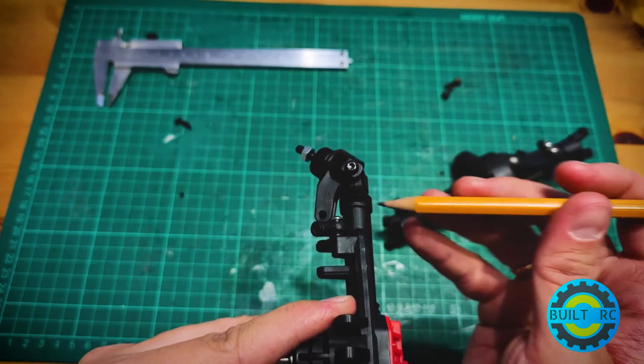I believe I will not assemble this axle on camera, because I will need to grease it inside. Also, I will need to put a smaller bearing here, because I had this bearing off to be replaced, because it was rusty and with excess movement of the pinion inside it, and I didn't have the appropriate one on hand. I believe this one should be like 4 millimeters in width, and I had only 5 or 6 millimeters in the local store, so I took it just to be able to drive the rig, and ordered the appropriate one.